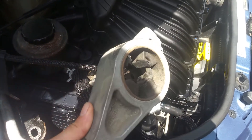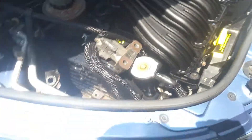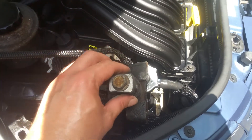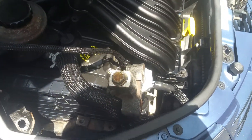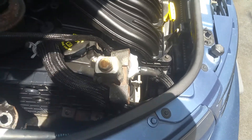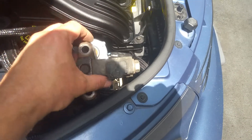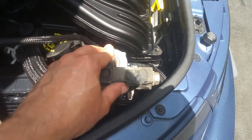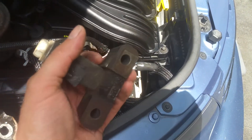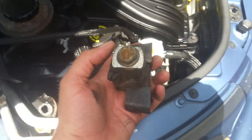So we're going to go ahead and get our other one over here. We need to also remove this 18 millimeter bolt here, so we'll go ahead and get on that. I'm going to use the impact to get it loose. If you don't have one, you'll have to get this thing held — in a vise probably, or figure out something to hold this while you're plugging that loose.